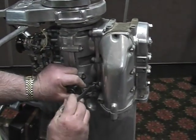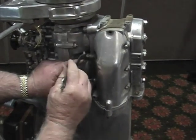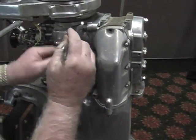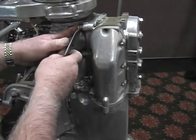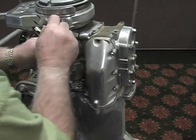During this process, while the mechanic is disassembling the motor, it's not like he needs to be necessarily watched by the mechanic or the inspector in charge, but we usually have what we call a watcher, and the watcher will keep an eye on where the mechanic is going so he doesn't remove components further than the instructions given by the motor inspector.